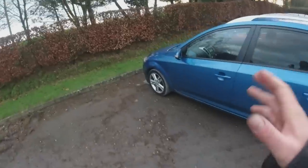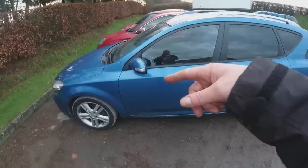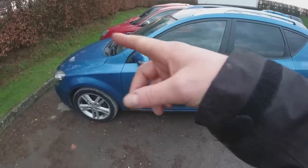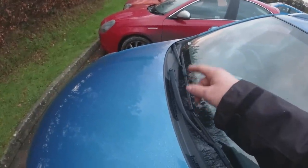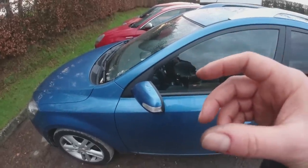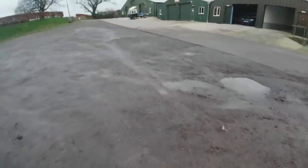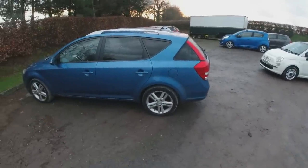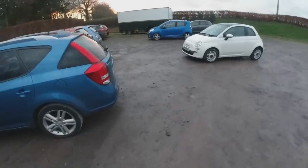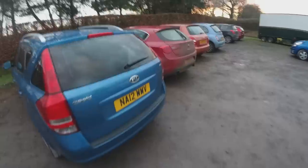A huge amount of you commented saying you've had these and you all had low clutches. I've seen a huge amount of information on people changing the clutches out and getting no benefit from that at all. There are a couple of other things to try first - I want to hold the pedal down and leave it overnight to see if the arm comes back on the clutch and check for a fluid leak. Reading up a lot, there is a clutch damper in the system - a little cylinder with a rubber diaphragm inside that is supposed to take up movement within the clutch. Apparently the diaphragm goes and allows fluid to pass by it, which gives you a low pedal. You can blank it off, and that can improve things as well as swapping out to a new master cylinder. We'll try those things to see if we can improve that clutch pedal, but the subscriber will decide whether he's happy with it or not.